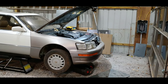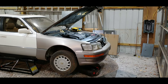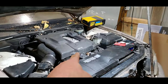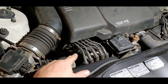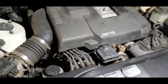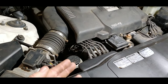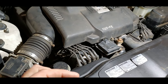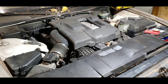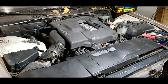I was going to make a video of me trying to diagnose what the problem was. The car was actually misfiring. It turned out it was all because of me. I changed the water pump on this, and there is a sensor for each cam to tell you the cam position. Somehow the wires on this one got chewed up — I'm guessing it was a belt going by or something caught it. It chewed up the wires just enough to make the engine misfire, and it was random. Luckily, I tore the engine down a little, found that sensor, and replaced it.